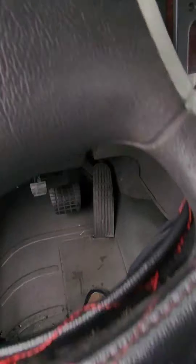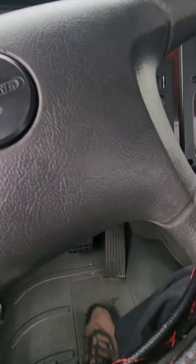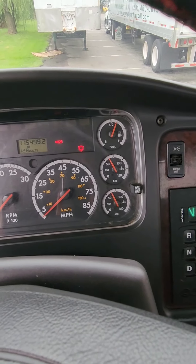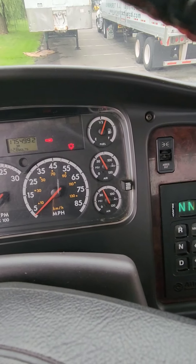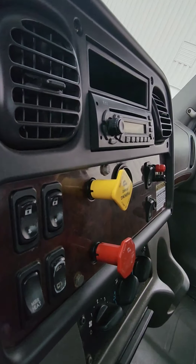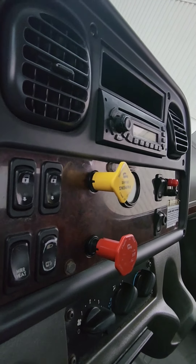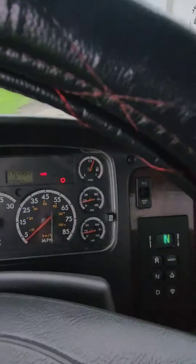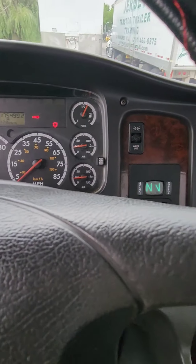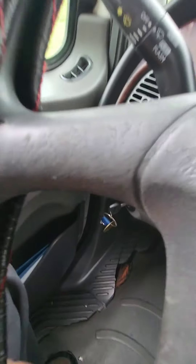Release the brake and stop the stopwatch. I did not lose more than four PSI within a minute — that tells me there are no leaks in the system. I will fan the brakes down to below 60 PSI and my low air warning light and buzzer should come on. Those are on, meaning they work properly. I'll continue to pump it down below 40 PSI and my valves should pop out. Watch the valves, not the gauges, because it could go off at any time. One popped out — keep going until they're both out. My spring brakes have popped out, telling me they're working properly.